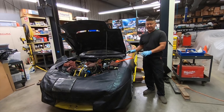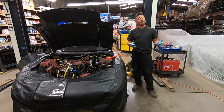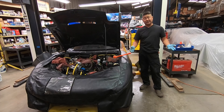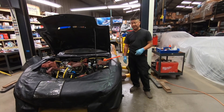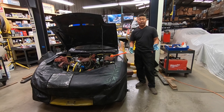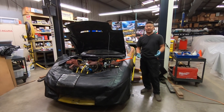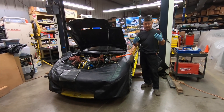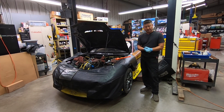Any time you have a race engine — the RX-7, the NSX — we always prime the system. The advantage to an external dry sump pump like the NSX is we can turn it with a hand wrench and oil the system before fire. The RX-7 still uses a factory oil pump, so we have no way to access it. So any time an engine is sitting and it doesn't have an external pump, what I recommend is disconnecting the ECU and pulling the spark plugs, because even if you don't light it off you still have compression. If you pull the plugs, you reduce the load.